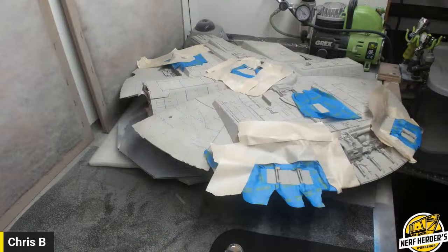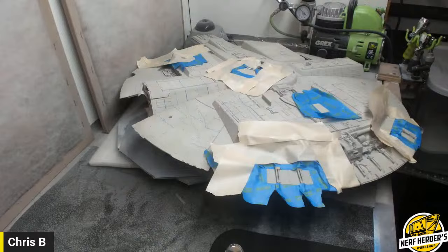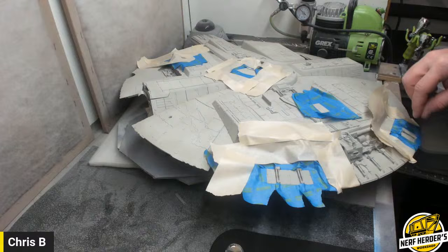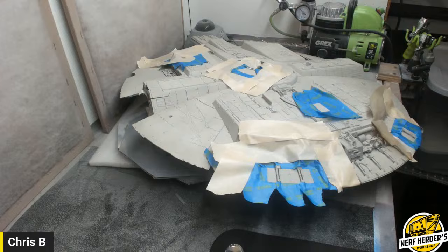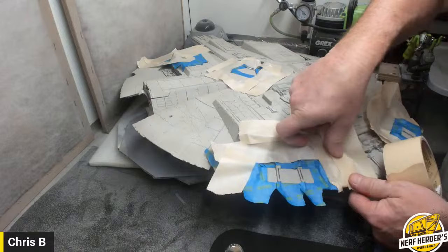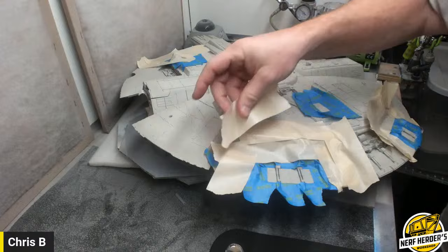Another thing I want to point out — I like to tape around because especially with red, even if you're just spraying straight on, the mist goes all over the place. If you don't tape around the edges and try to keep it contained, you will get little specks of red all over that you'll have to tape up later and respray the base coat. It just seems to usually be the red that does that.